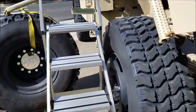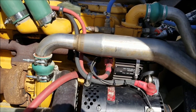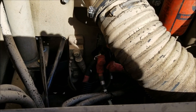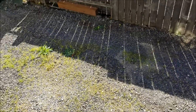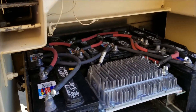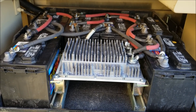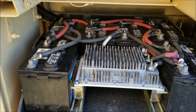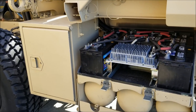I got a lot done today but it took a long time — very tedious and time-consuming work. I got two hot wires of brand new welding cable ran from the alternator to a junction block that I made up, and I got rid of that polarity doohickey. Let me show you the battery box first. Everything from the junction block is new wiring, and this is a precursor to an upcoming modification — I'm sure you guys can figure out what it is and why I used welding cable if you think about it.